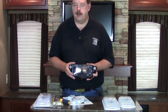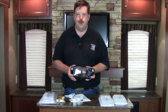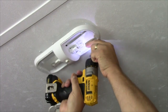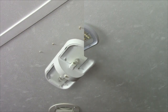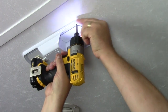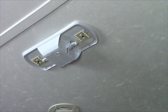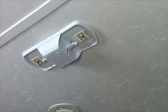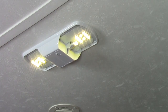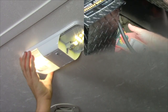Now that we've gone through the different kinds of lights, we're going to install all these products on the coach and then see what our power savings really looks like. Switching out the fixtures is pretty easy — just follow the instructions and proper wiring practices. Make certain the new fixture is connected correctly as these LEDs are polarity sensitive. The new holes for the old fixtures probably won't line up, but just screw the new fixture in place using the old screws. In some cases you may have to cut a slightly larger hole for the wiring, which can usually be done with a utility knife.